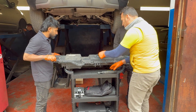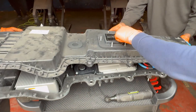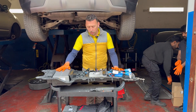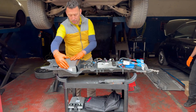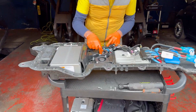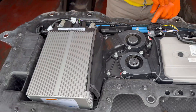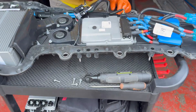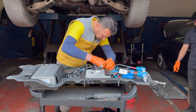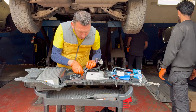Let's see the big battery of the Range Rover. Within this box here are the components. This is the 48-volt battery — if you think about it, it's not that big. And here we have two tiny coolers: one for the battery and one for the DC-DC inverter, which is the part we need to replace. We'll need a screwdriver to take the plug off and a 10-millimetre socket.